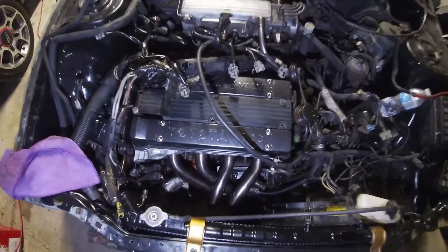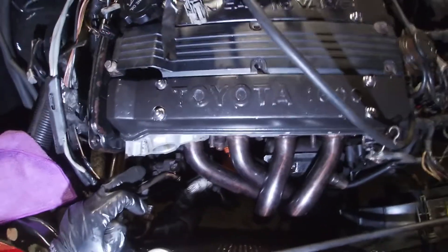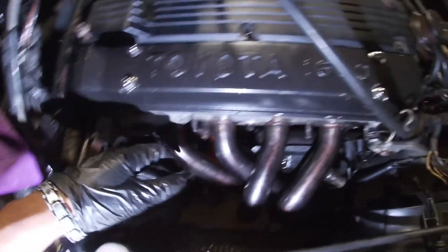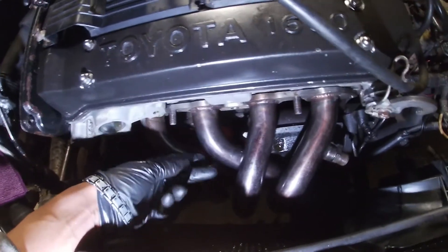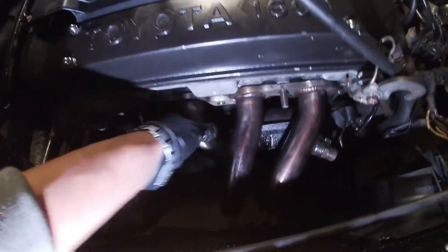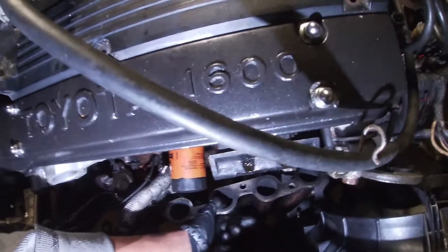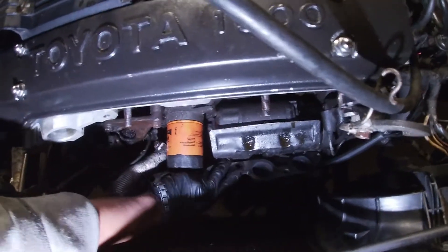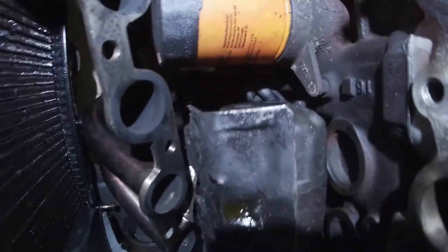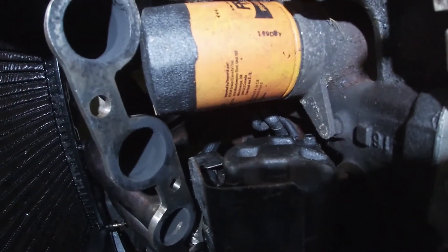While I was struggling with that one wire, I kind of forgot it was a little tricky. So I disconnected the distributor and disconnected the headers — there are 14 millimeter bolts, about five of them. I'm just going to drop the header and take it off so I can access the cable that goes right down there. I'm going to go ahead and disconnect that right now.